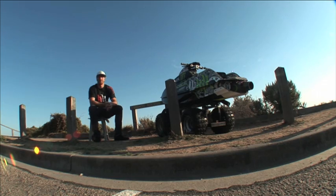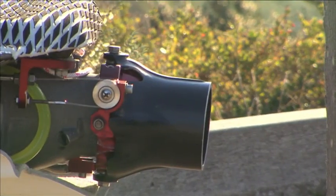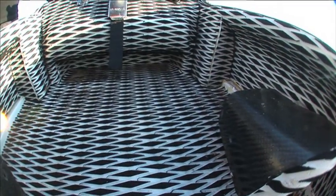The hulls come with adjustable engine beds, dual cooling lines, and scuppers. We generally put a trim cable on there, which tilts the nozzle, throwing the nose in the air, which helps with your inverted tricks. Every surface that our foot would touch, we cover in HydroTurf, giving us more grip in the surf.